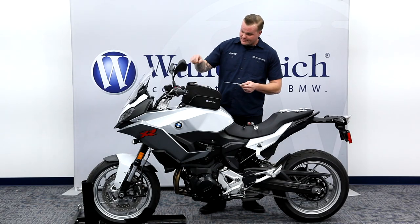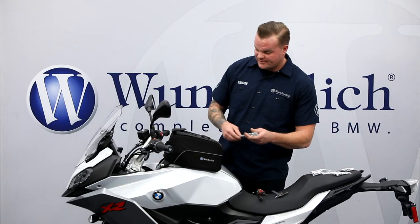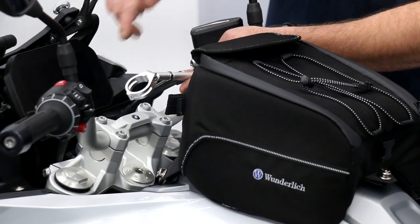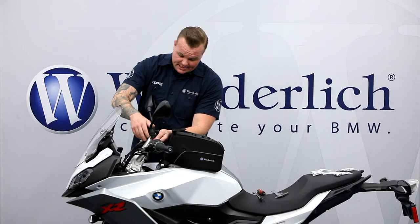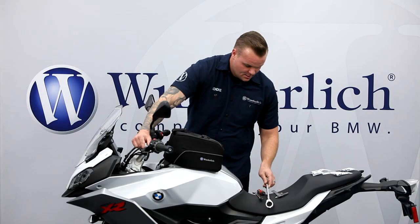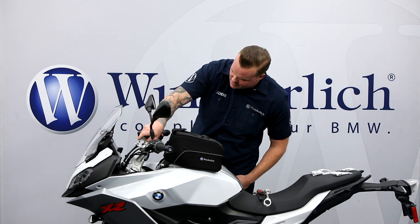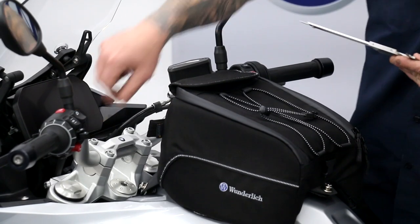What we're going to do is measure on the bar where our crossbar is going to attach. Since this is a tapered tubular bar, we're going to want to measure where the taper is in this particular application. We'll take the caliper and make a measurement — this one looks right about 25 millimeters. It is tapered, so there is a little play.